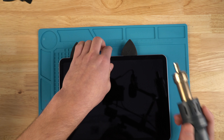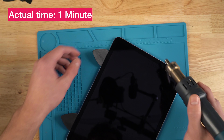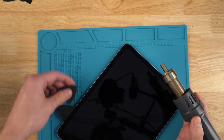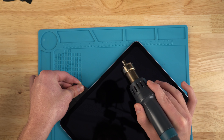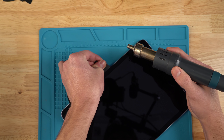As you can see, I didn't end up cracking the LCD anymore. If your pick falls out, come back to where you placed the other pick and slowly work back there. Apply some heat and then slowly work your way back to where you were.